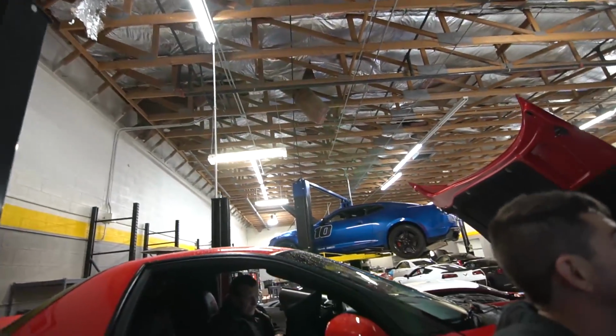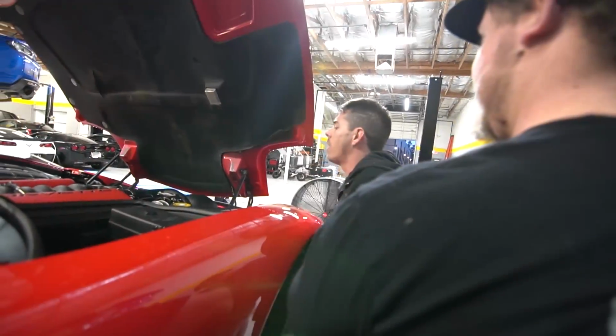Belt slipped and only made 400 when we first ran it. I just tightened it way up and went up to 660. Yeah? So if he's been driving it around like that with the belt slipping, he's probably going to feel real fast.